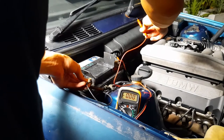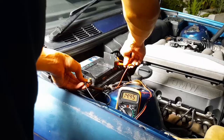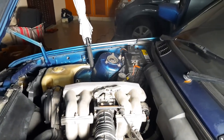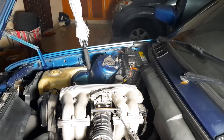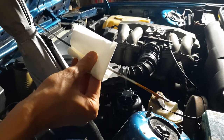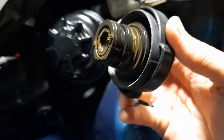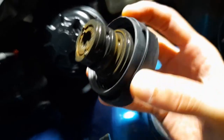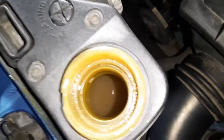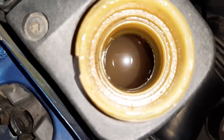With the engine running, we can also make sure that the alternator is working — looks good. There's some white smoke coming from the engine, but I think it's engine oil on the engine that is burning off. The engine oil level looks good. The coolant tank cap looks good and there's no sign of any oil, but the coolant in the tank looks strangely brown — I hope it's not full of rust.